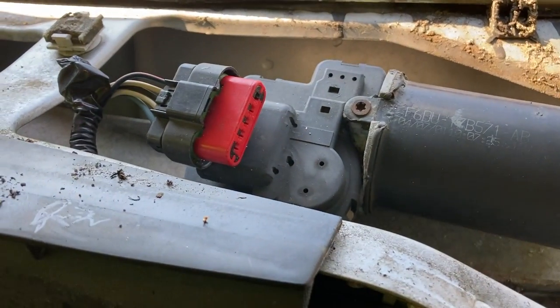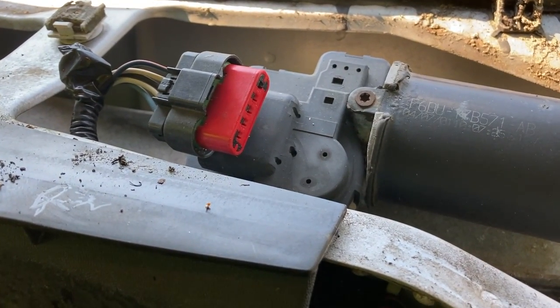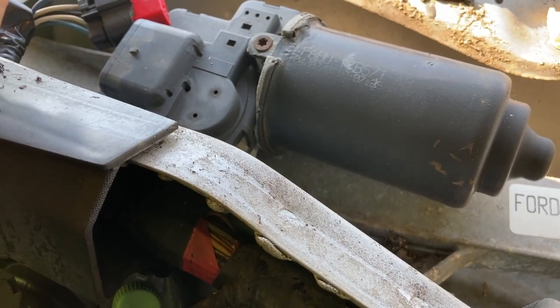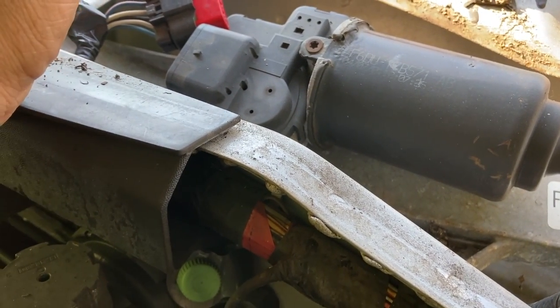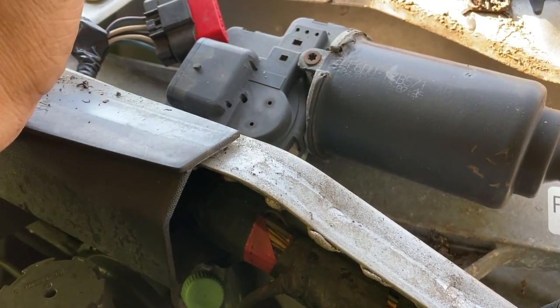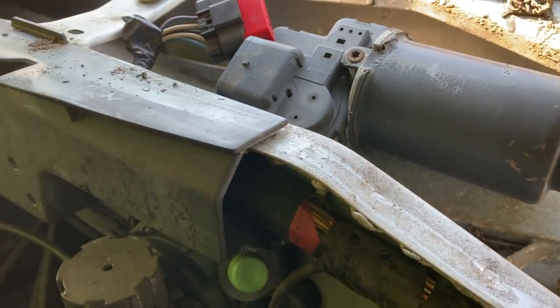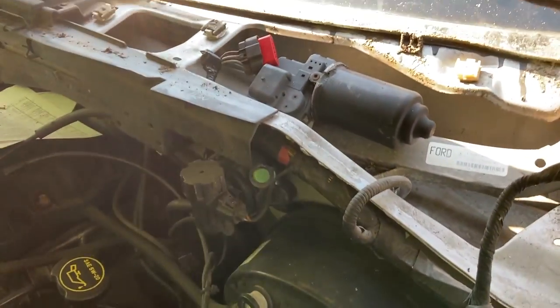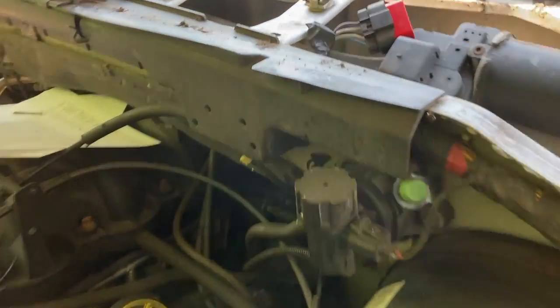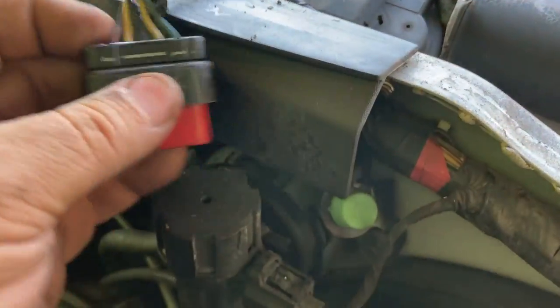Wow, it just decided to start one day on my way to work. Now I've got to see what I need to do to get this wiper motor assembly replaced. Something in there - I guess the GEM module is dinging to say the wipers aren't parked or something. That's what was causing it. I'll go ahead and check powers and grounds on this real quick just to make sure. We have a good ground, so it's the wiper motor.